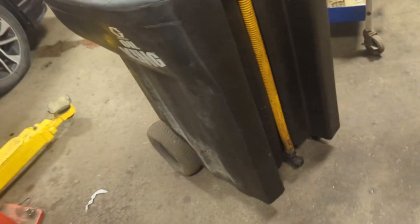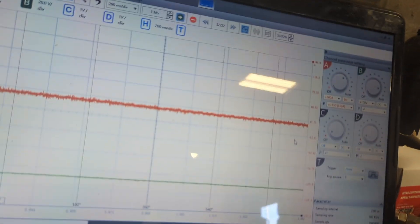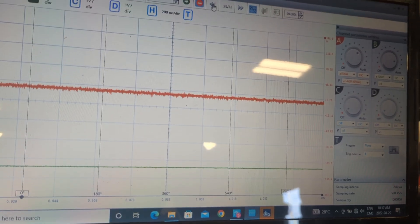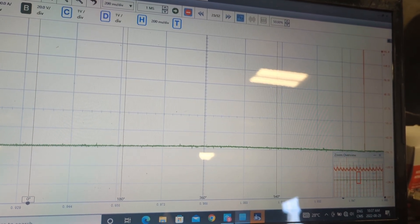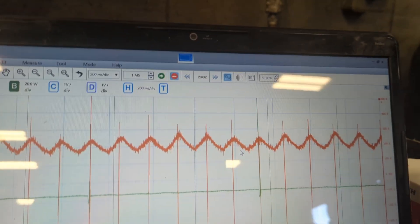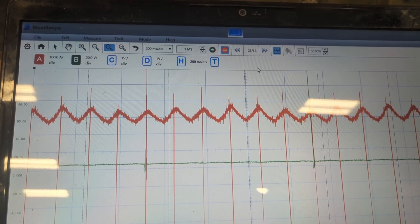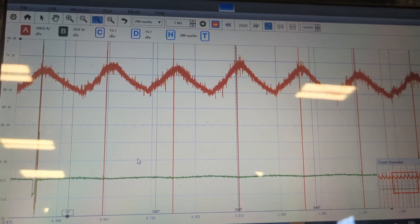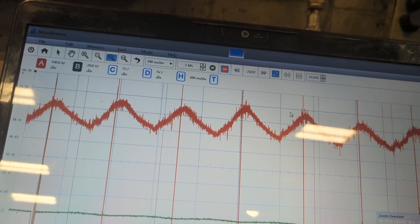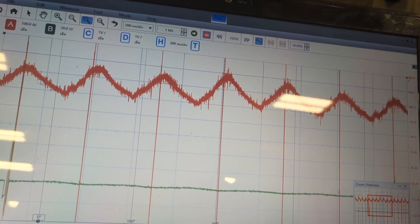That does not sound good. I had it up at 500 amps and I think it buried the needle at 500. Let's come over here before I lose all my data. All right, so let's see what is going on in here. From here to here we are not actually seeing too much of a difference — well, number two is kind of low. Actually there are a few of them that are kind of low. First thing we're gonna do is go get the firing order and sync this with the firing order.